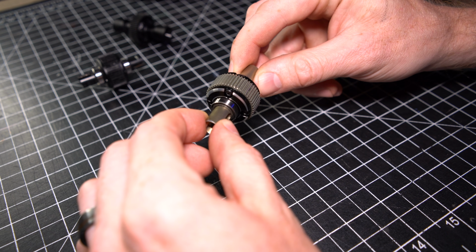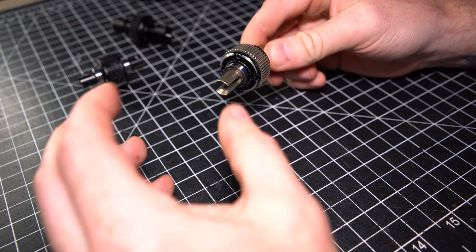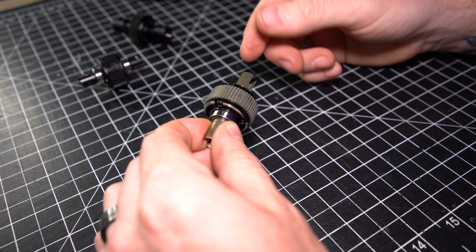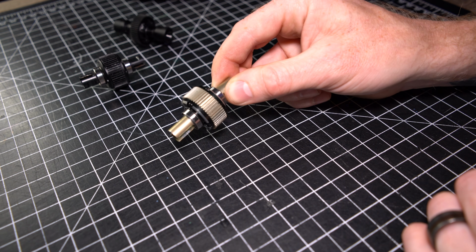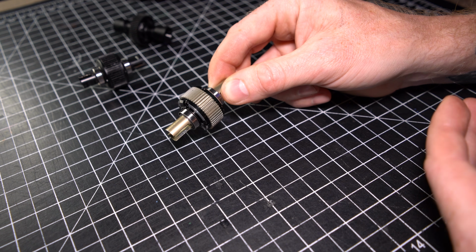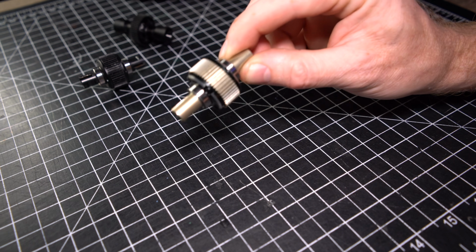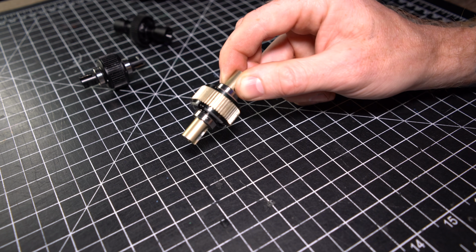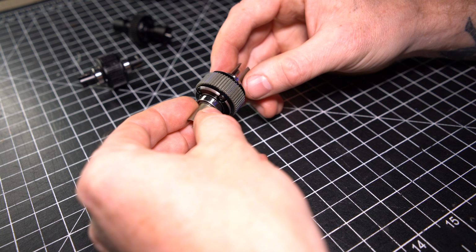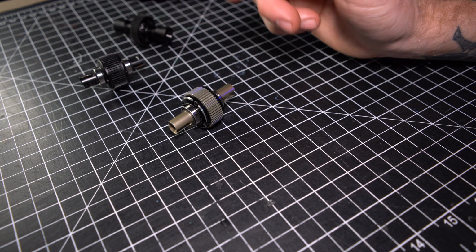So when you're in the corner and you need to get on the brakes, you can actually see the inside wheel sometimes slow down compared to the outside wheel. Very little maintenance. Sometimes I've seen videos where guys blow these out, but they are probably running on a higher traction or higher friction surface than what I'm running on with polished concrete. Since we run on polished concrete, it's very low friction. I haven't personally had the need to rebuild this diff. It's still as buttery smooth as it was the day I built it.